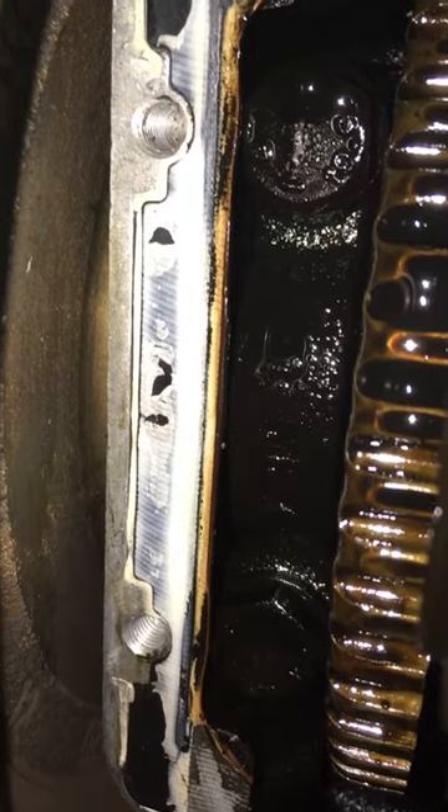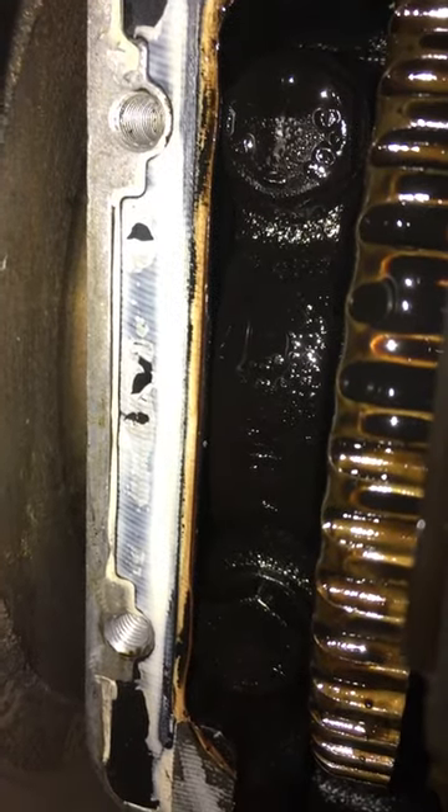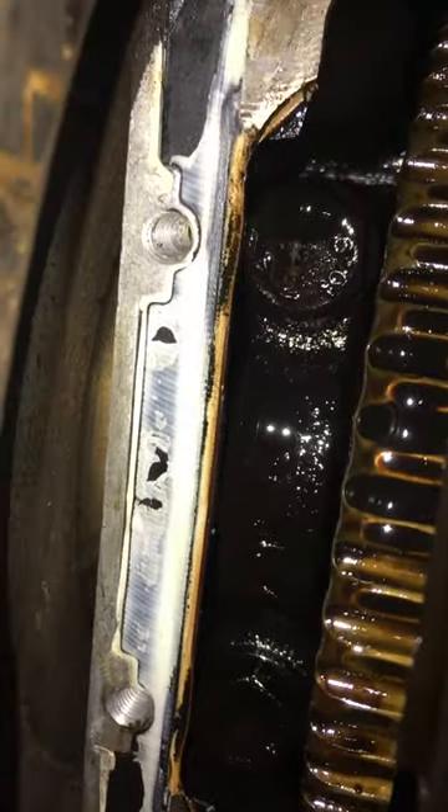Just a quick look at where the 10mm bolts go. At the gearbox end, those two were quite fiddly to get to, so I had to use a ball-end allen key — the 5mm. Just a quick look at where these 10mm bolts go at the back, and then again on the end. All pretty easy and straightforward to get to.